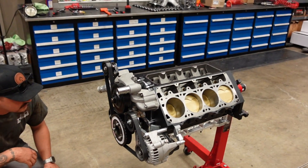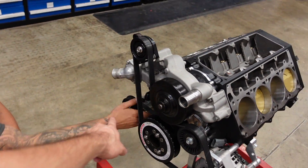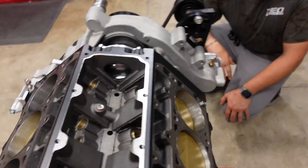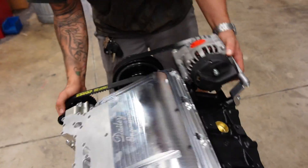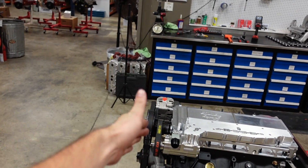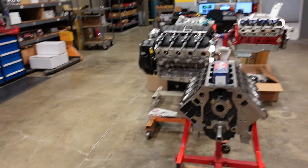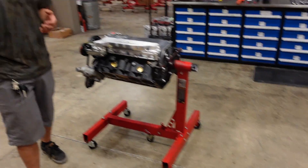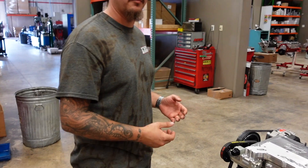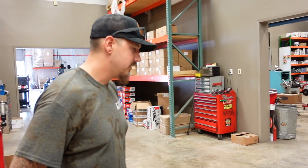Roughly a few inches higher than the valve cover — definitely going to turbo a stock block build. What's the clearance on the rear of the timing? The fan's on there but there's nothing behind it — half inch, maybe? It's tighter than that. We just want to make sure there's no restrictions. I don't know what turbos you're running or how much oil pressure they need, but normally it's not an abundance of oil going through them. As long as we have enough space where there's no restriction because of the back of the block — there won't be, I'll make sure there's a gap.